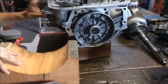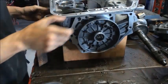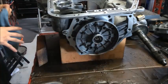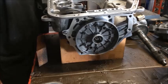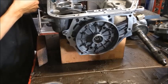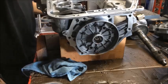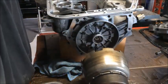To set the transmission up to reassemble it, I've got this piece of wood cut to fit the case to give me some stability. We've already done the rear overdrive piston retainer gasket which goes behind it, and cleaned all the passages in there. We've already done our rear band and both of these servos — front and rear band servo. I haven't tightened my rear band yet, but I don't want to do that until it's assembled. So I'm going to take the planetary gear assembly and all of these things and reinstall it in the transmission.